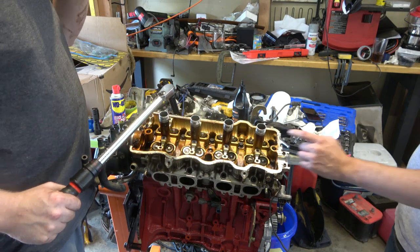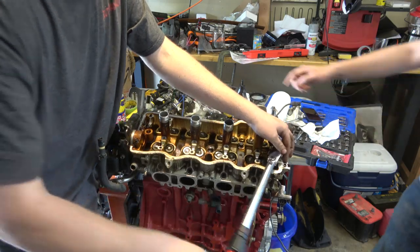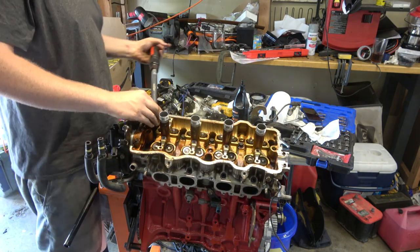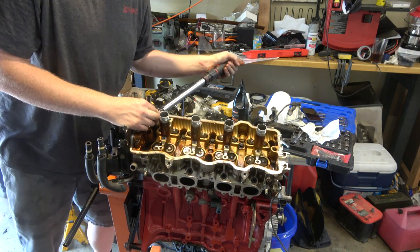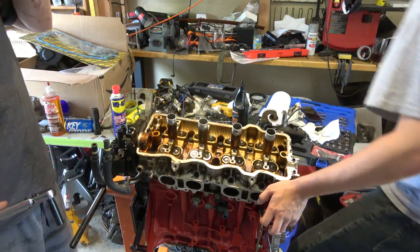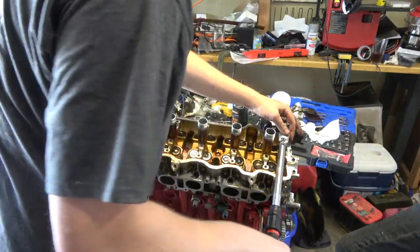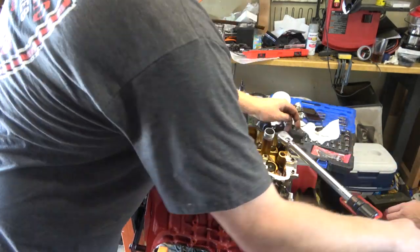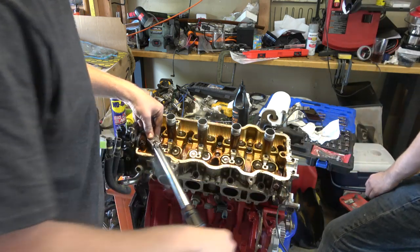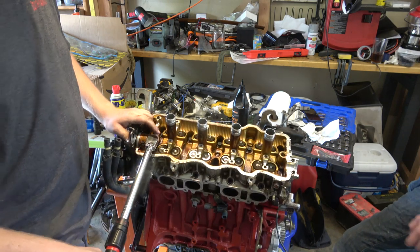Okay, so we're at six. So we're going to go all the way to the front here for number seven. Front of the line. VIP. And back of the house, number eight. Damn it. Okay. Coming over here, tubes. The one time you want. Okay, so the eight. And we're on the outside here for number nine. Catch me outside. How about that? Oh, God. Don't even start that. Okay. One more, any more? So that was nine. We're going to go to number 10 up here. It just barely fits. And that is the end of our sequence. Now we have to go back and apply the 90. We're going to do that after we recheck the torque.